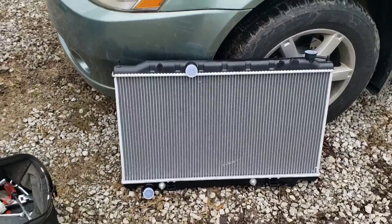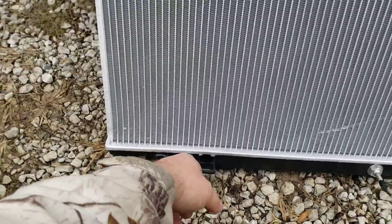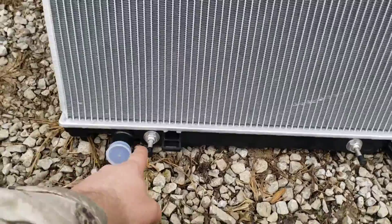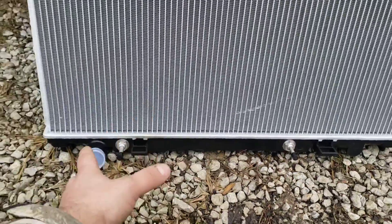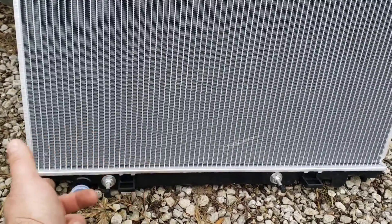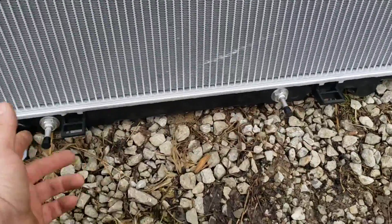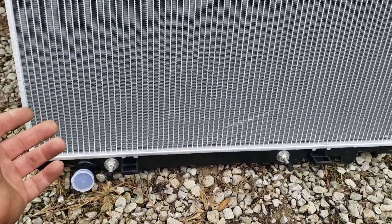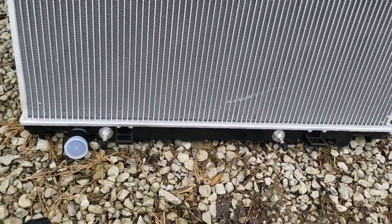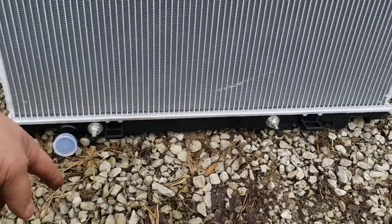This is the back side of your radiator here. You've got a big pipe that's going to go in there, a big pipe that's going to go in there — that's where you fill it. If you have a manual transmission, it may not have these. A lot of radiators you buy, at least if you buy them online, they come set up for either. This is an oil cooler or trans cooler, one or the other, and you have lines run into this — the lines will run that fluid into the radiator one way and back out the other.